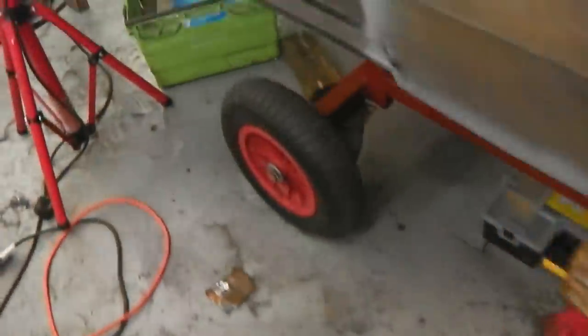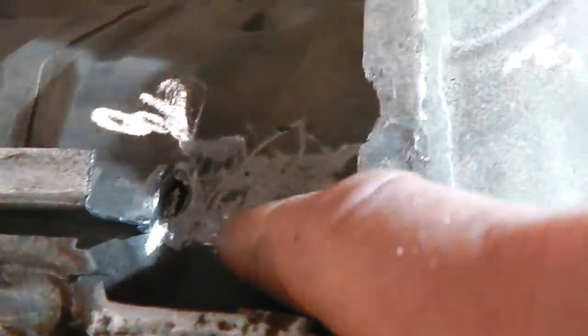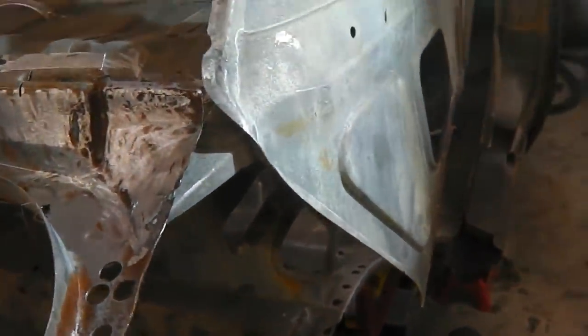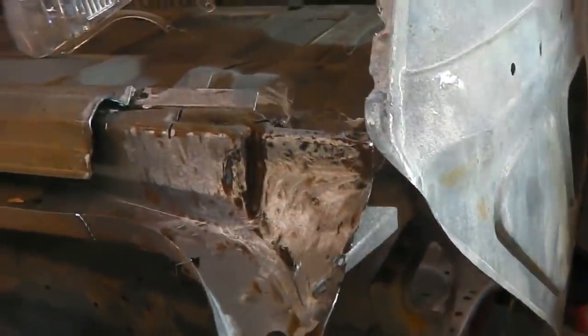Whoops, there goes a little tub, nothing in it. Back across to the car, a little bit of rust killer on there, and then we'll put the rust converter on any bits that don't come up quite clean. The rust converter will turn it inert. Then make sure we're all right to get the rest of the metal landing in the right place, and that this area is cleaned and well through-primed. Then we'll place that in, make sure that it's lined up. We can start getting some welds onto it, and that should finalise that little area.